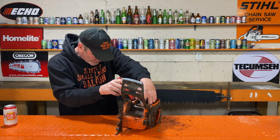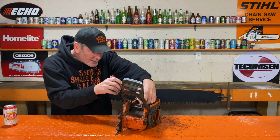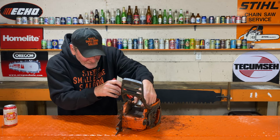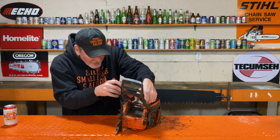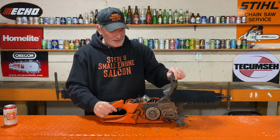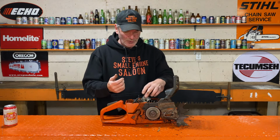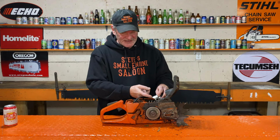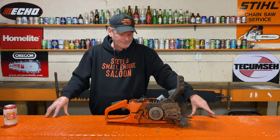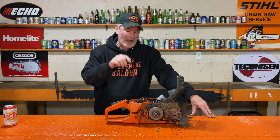And bet you it's gone on this side too. Absolutely gone. There's three balls that are all touching each other right there. So there you go. What happened right there was that those little spacer shield things blew out of there, jammed in the intake side of the piston, busted that piece off, and seized that sucker solid. So on that note, now we know why it was seized.